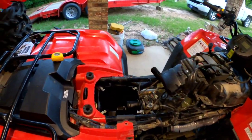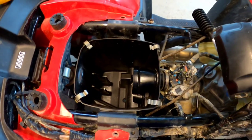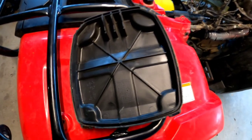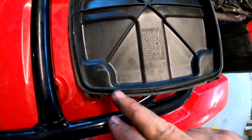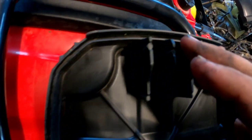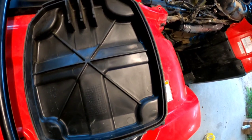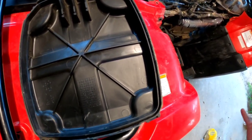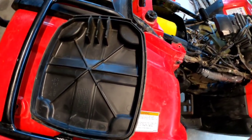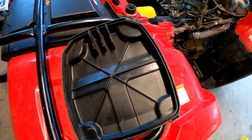The last thing we're going to do is run silicone around the airbox and put the lid on, but first we'll put our new filter in. Take the black RTV silicone, run it in the ridge all the way around, put it on your airbox, snap it down, and let everything dry overnight. By morning check over everything, make sure everything looks good, and then go full send - go test it out in some water.